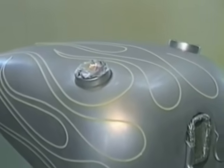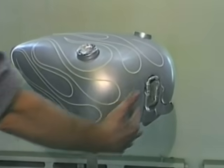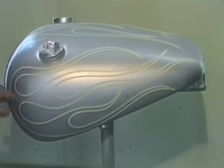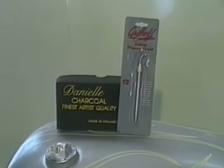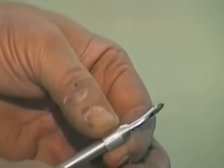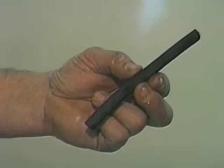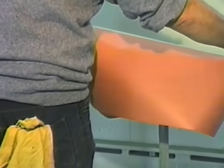Now that's aesthetically fairly pleasing. Let's talk about what it takes to duplicate this design. The paint will be in the front, and different colors will show that further on in the tape. Here's our design — a self-contained flowing flame design, very easy to lay out. Now we go to the artist supply store and get some artist charcoal and a number 12 pounce wheel — it's a wheel with little teeth in it, very much like a spur on a cowboy's boot. It punches small holes.